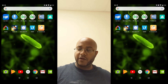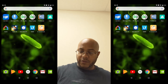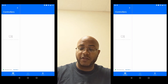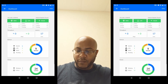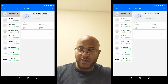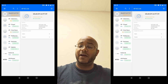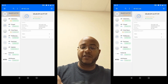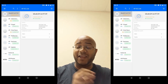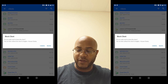Let me log in here — I want to show what it looks like to be on this controller, because we have this set up here at my church. So I'm here on our UniFi controller. Looking at Devices, you can see this is the access point we just set up. I don't want to adopt this because this is a standalone device. If I was installing a UniFi controller there, I would just let that control this. But this was showing how it can be standalone without all that — it just plugs into your existing router. You see it shows up, and it will show up as a client as well, which is completely fine.